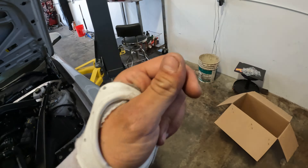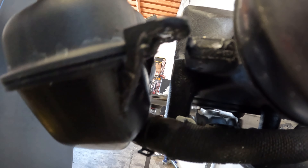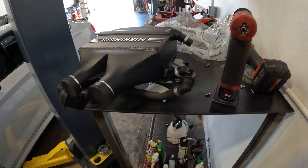I ended up clearancing this little pedestal here for the reservoir — as you can see, the bolt holes are lining up now. Originally when I put the thing on it was kind of like this and it was stressing the plastic out, so I created a little extra clearance on the plastic. I beveled that bracket just a little bit in this area, this channel, as well as right here, to give a little more room so we don't have to stress the threads out. Got a little bit of metal shavings on her but basically she's ready to go.